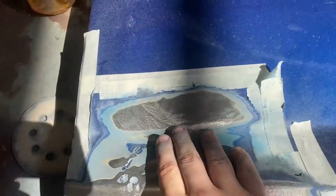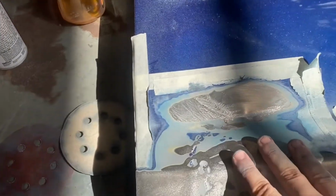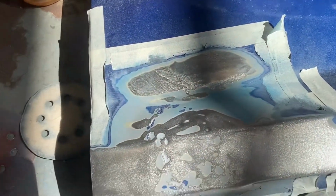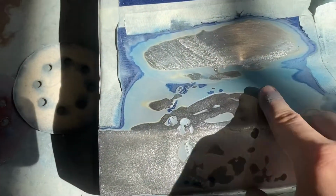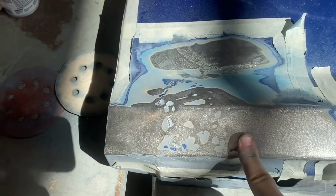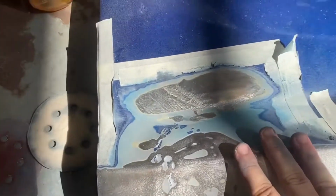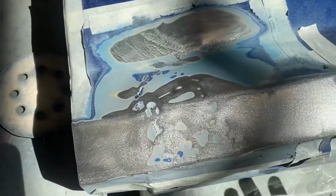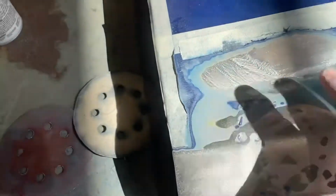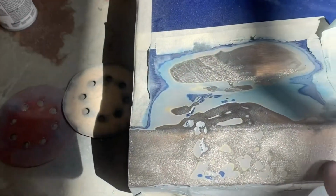But now that I feel it better, without the bondo on, there's actually a dent going outwards, like this. So I might use a hammer and dolly and try to get that even. But I'll first have to ask and see if that's the right thing to do. But other than that, I'll continue sanding and try to get as many patches of bondo off as possible.